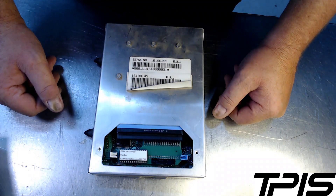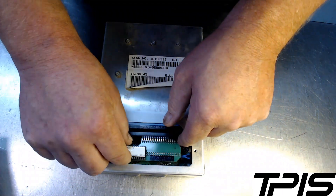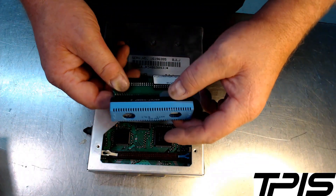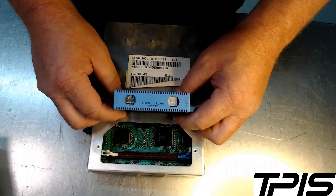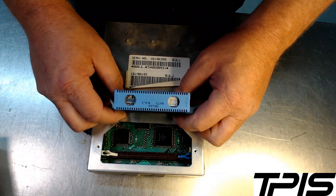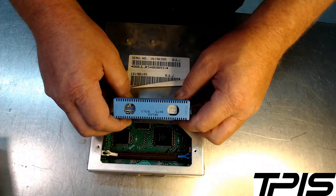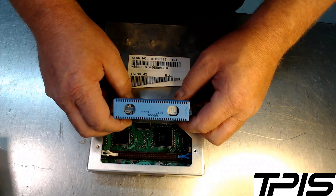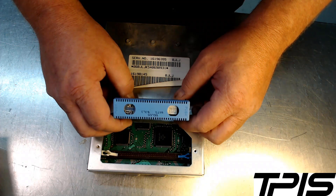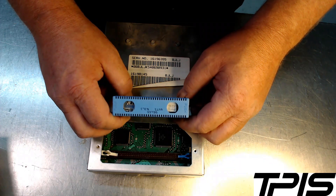Once you get your PROM installed, you don't necessarily have to put the computer back up under the dash right away — you can make sure everything's working properly first. When I make a custom PROM for your car, I always do it with the base timing from the factory in mind, which on a TPI car would be six degrees. TBI are typically zero. The fuel pressure rating on TPI cars is right around 42 to 44 pounds, always with the engine running and the vacuum line off the regulator. TBI is typically in the mid-teen numbers, 12 to 15 PSI, unless you have an adjustable regulator. Thanks for watching and I hope the video helped.